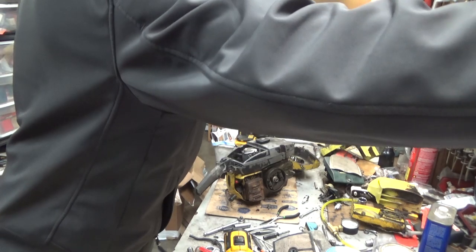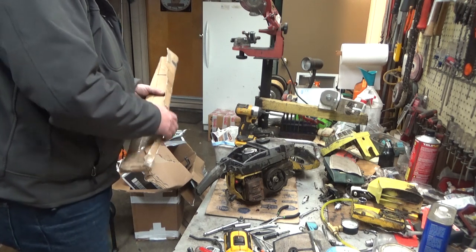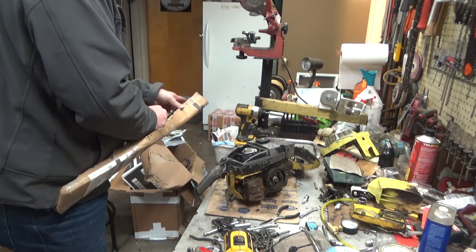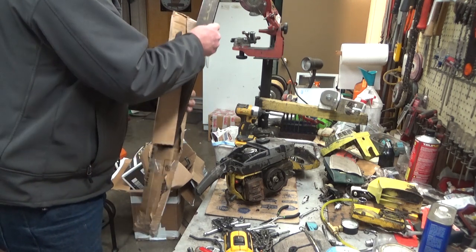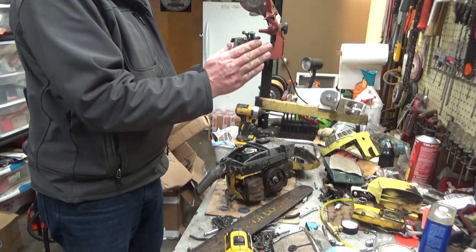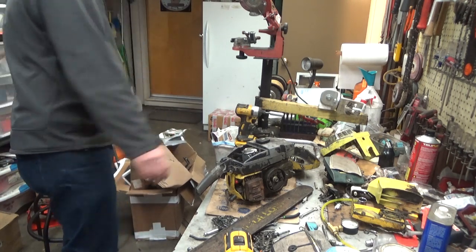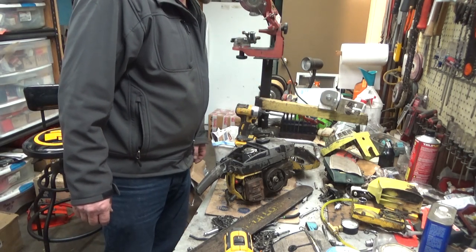Ever since my dad and I had to drill out, I think we did it. No, we didn't do it on the vehicle. That would have been too stupid. The old '65 Chevy busted an exhaust flange nut and bolt years ago when we were putting a different engine in it, and we tried so hard to get that straight, but when you're using a hand drill and a vise, you're not going to get there. So it ended up being cocked just a few degrees off, so getting that flange up there... Ever since then my tolerance and joy for drilling out broken bolts has been low, because almost always your bit wanders just a bit, just enough.